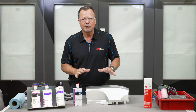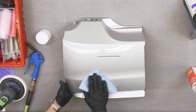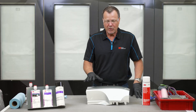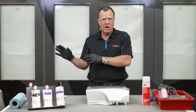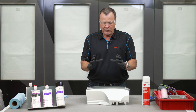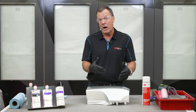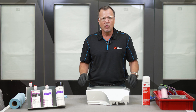Before we get going, I'm going to clean this bumper up and then we'll get started with the adhesives. You always need to clean with soap and water first — that's something I did over in a separate wash bay. It's a good idea to wash the entire part, not just the small area you're working on. If you only clean small areas you could drag contaminants into that clean area, and cleaning the entire bumper may also reveal other damage you hadn't seen while it was dirty.